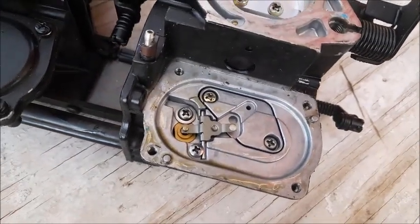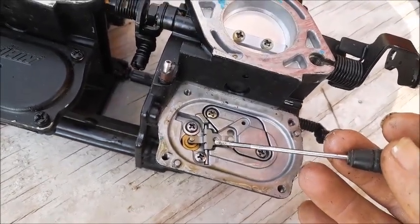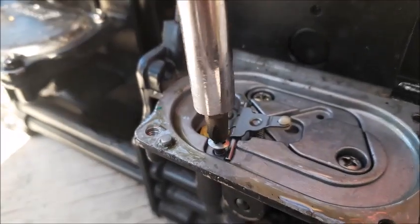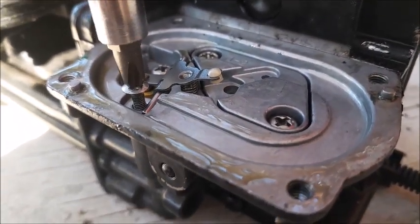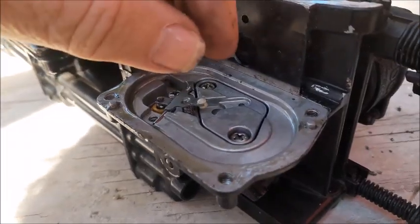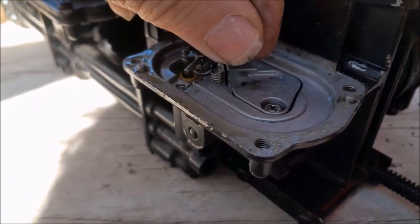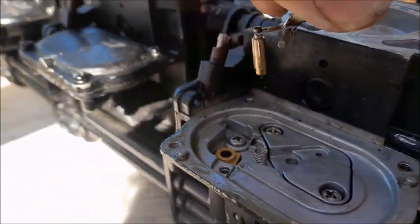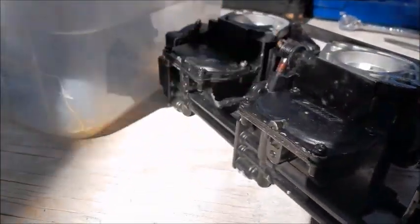So you've got four screws inside this cover plate. The first one right here — you take that out and you're able to lift out this needle valve. You can see how there's a spring on the back side of that lever for the needle valve, so remember that spring is there so you don't lose it. Now this needle valve, spring, and the crossbar just lift right out of here. The crossbar could actually slide out of that piece if you want, but it's not necessary.